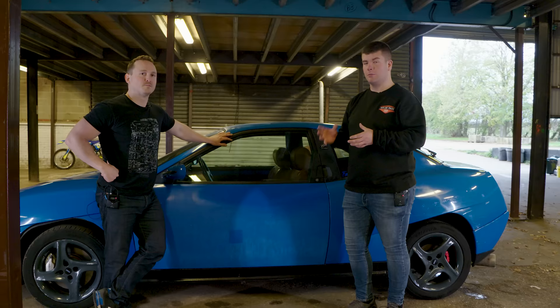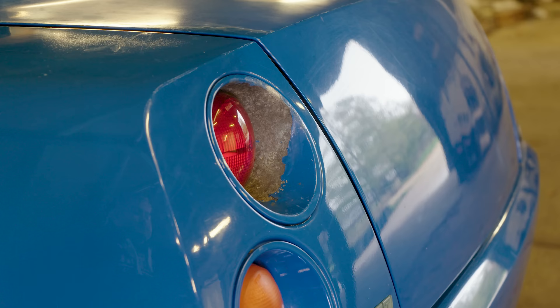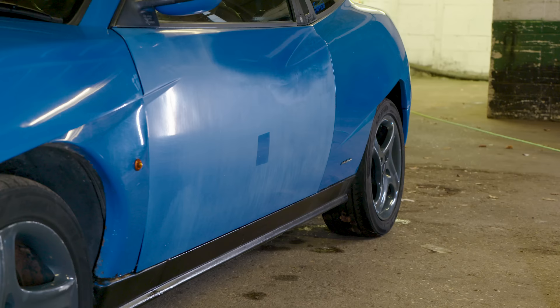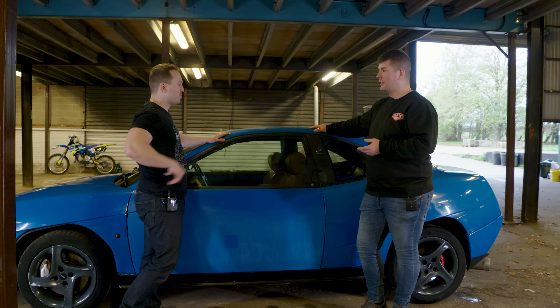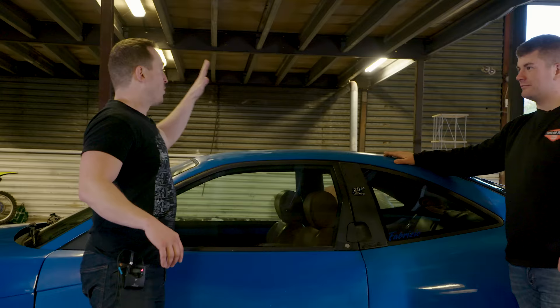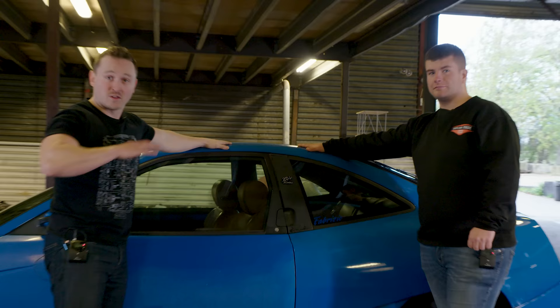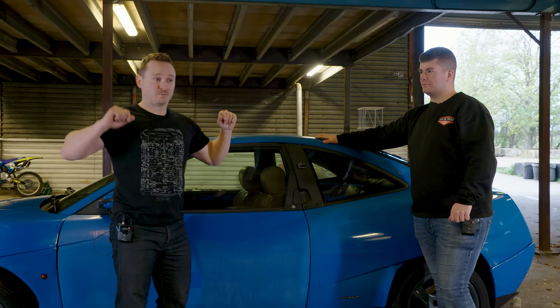The rest of the car has quite a lot of lacquer peel and I'm pretty sure it's all been painted — there are signs of filler, paint reaction, moisture in the paint and various other things especially on the roof. There's a little section here that looks like it has moisture in the paint. We are going to take sanding discs to the whole car, get it back as much as we think we need to, then fill it, prime it, paint it and then lacquer it.